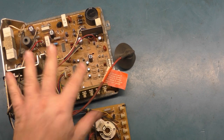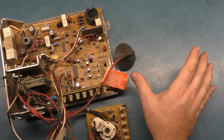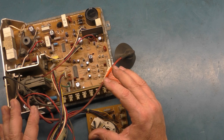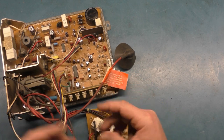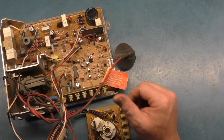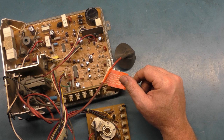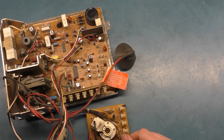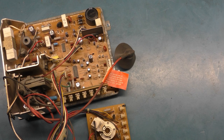This is 19-inch only — there's no 25-inch version. If you try to search this online, you get a lot of references to a Sharp Image KT-M26, and all the pictures cross-reference to this being the KT-M26, but that's actually not what this is. If you get a cap kit for the KT-M26, it's not in any way the correct cap kit for this chassis. From what I could research, there's no actual designation for this model — it's just a Sharp Image K7000 clone.